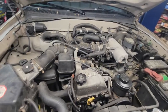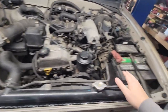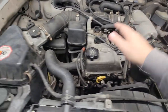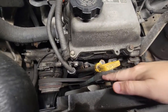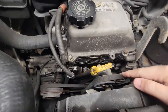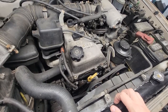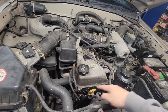For those of you who have never done a head gasket before, here are some basics. We're going to be taking off first: the battery, draining the coolant, removing the air box, taking off the intake, removing the exhaust. Once we take out the radiator, we're going to remove all the pulleys. We'll be taking off the valve cover and removing the front timing chain cover. Then we align the timing chain to top dead center, and remove the timing chain itself and take out the cam from the head.